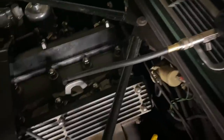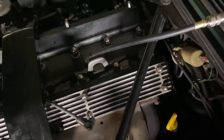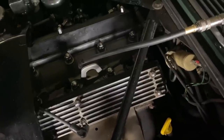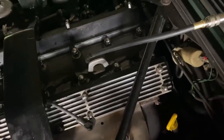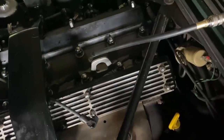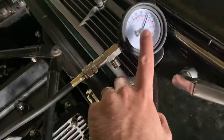I'm not going to drive the car for a couple of days. I'm going to fill up the top of that piston with ATF and let that sit for a bit. Hopefully that will clean out the rings a little bit. Then I've ordered new oil for this. I'll change out the oil after the ATF has sat and run down. I don't want to run that into the engine, then run it for a bit and see if the compression goes up.